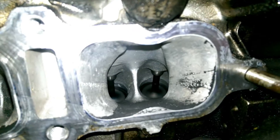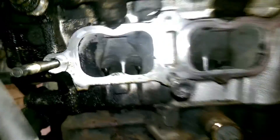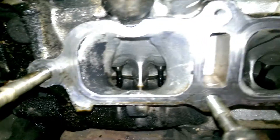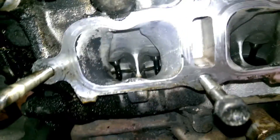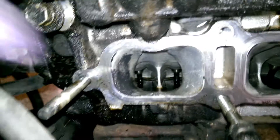This one's okay. This might explain why the exhaust ports on the other side are a different colour - if this has been leaking oil in, burning oil on that cylinder. It's pretty weird though, there's a lot there. Is it oil or fuel?